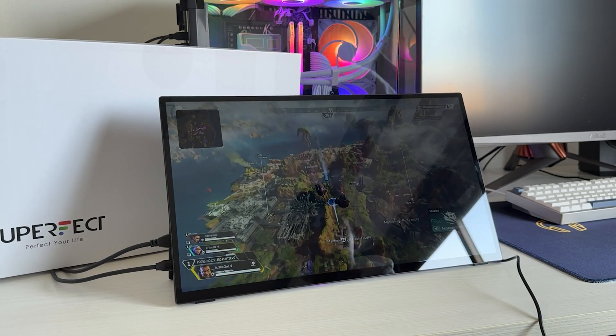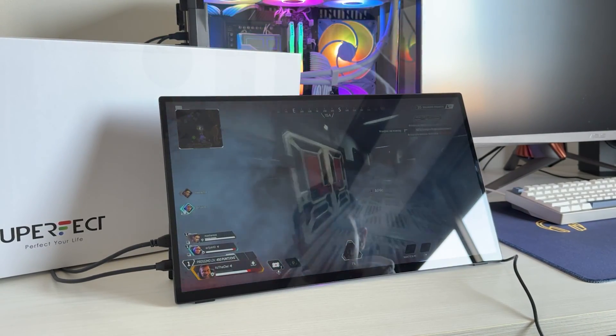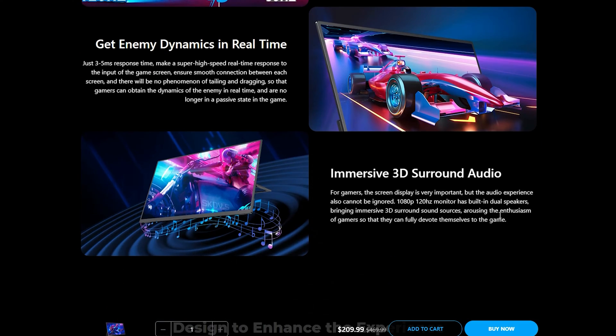My recommendation is that most of you will be better off buying a 1080p model. Going from 60Hz to 120Hz is a massive difference if you're gaming, so the refresh rate alone is worth it. Also, if your laptop is 1080p, you don't want a 1440p screen — it's either going to be upscaled with worse pixel density, or you'll have aspect ratio problems. I also find that most computers have their desktop configured at 1080p, so for troubleshooting client PCs I prefer 1080p. If you have a strong mini-ITX rig, a 1440p 144Hz model is fine, but for lower-end setups 1080p is the best choice.